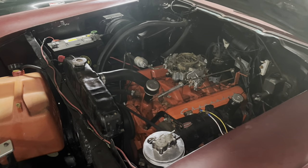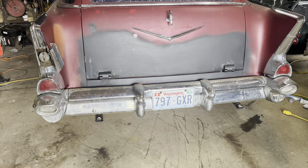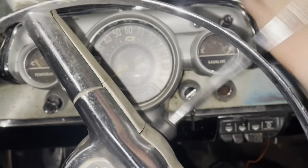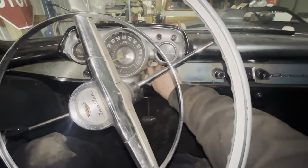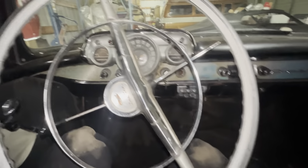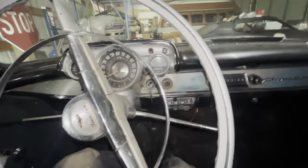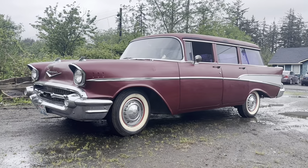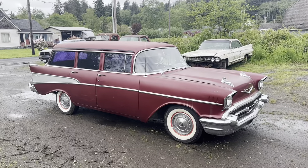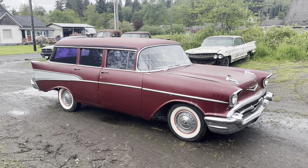I think today is the day. I haven't got the TV rod hooked up — time for a wee little test drive. It doesn't move anymore, so I guess it needs more transmission fluid. The dipstick was showing completely empty. The carburetor needs some love — it tends to flood out after it's been running. Hey, that's a gear! Here we go! It drove outside! And with it on the ground, due to the unique construction of the hydraulic ram assist, the power steering actually works — not sure it still leaks, but it works! It's got brakes and steering and charging and a fuel system.